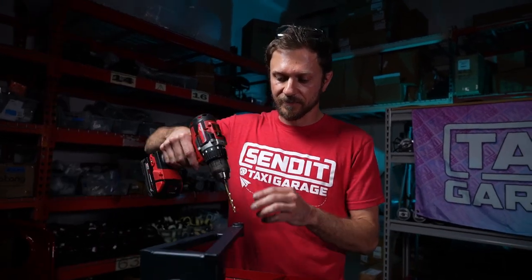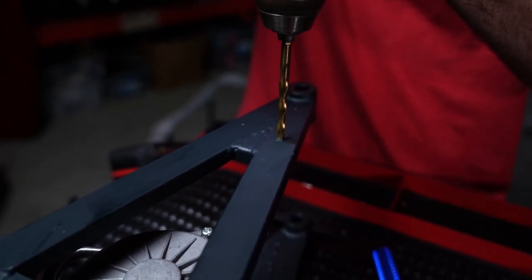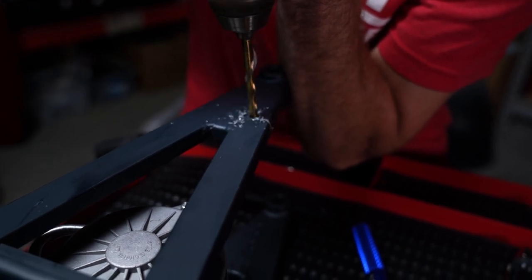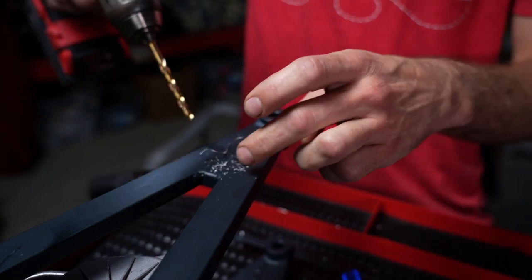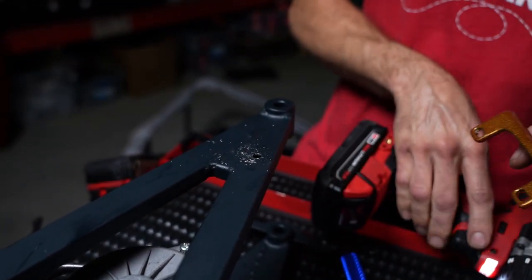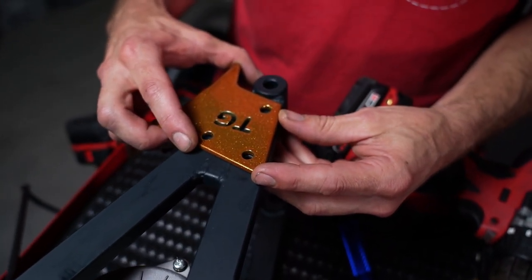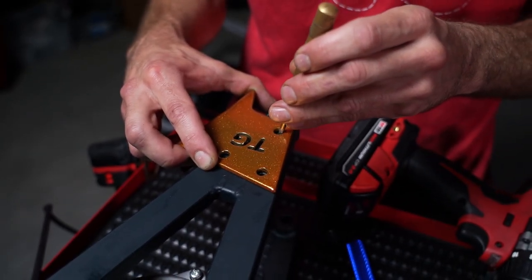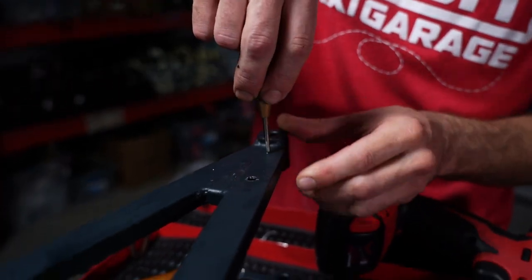Step five: take a quarter inch drill bit and drill the holes marked on the XL fork — always wear your safety glasses. Line up the quarter inch drill bit to one of the pre-punched holes, apply downward force, and drill through the first top layer. Keep the drill bit nice and square — don't go off axis — and you'll get a clean drill through. After drilling the first hole, confirm the other two punch marks are still centered, re-punch if needed, and drill the remaining holes.